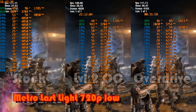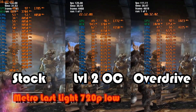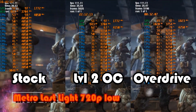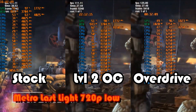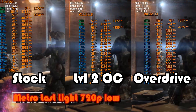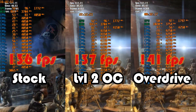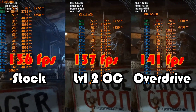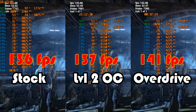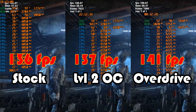Following Assetto is the benchmark staple Metro Last Light. The in-game benchmark seems to spread the load across multiple cores but never really loads any of them up. Stock held around 4.05 gigahertz at 56°C, ASUS Level 2 delivered around 4.15 gigahertz at 64°C, and PBO saw a consistent 4.225 to 4.250 gigahertz boost state at only 49°C. The resulting FPS numbers were uninspiring though — it all came out pretty close to margin of error territory, again due to the 1050 Ti.